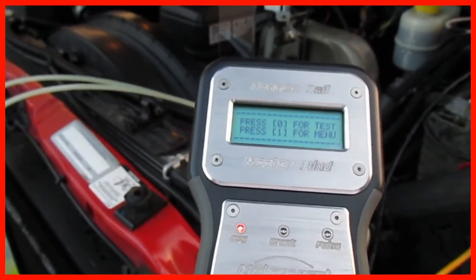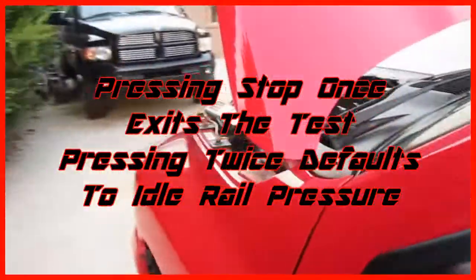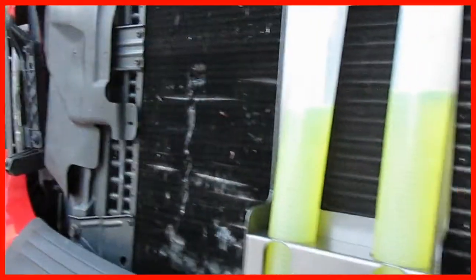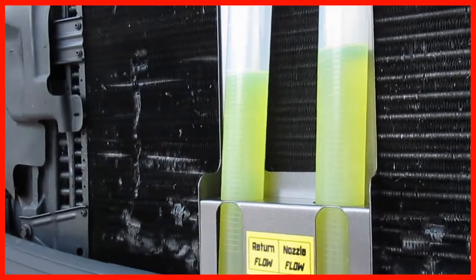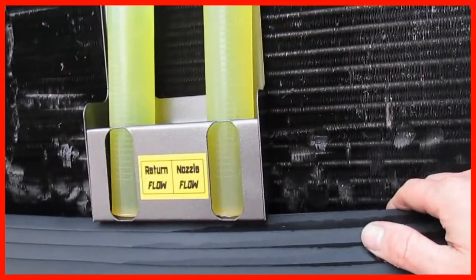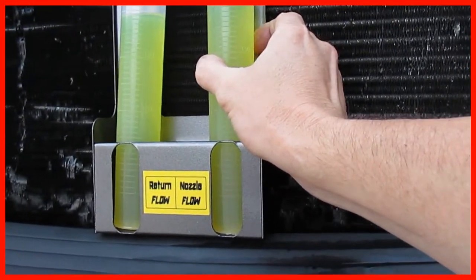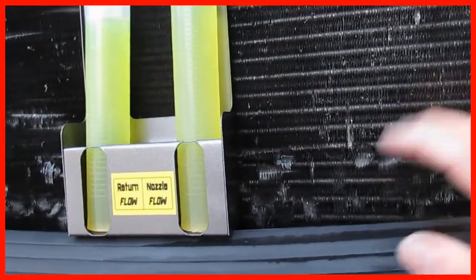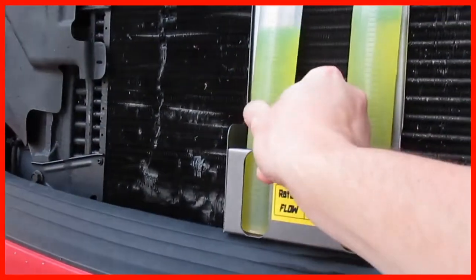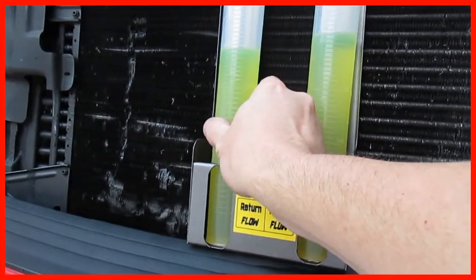Then we'll push stop twice — it brings our idle right back down where it was. And that completes the 1600 bar test. We were at 117 or somewhere along those lines. This is a stock injector that we've got in a fixture, and it looks like we put out about 212. I think we were at 117, so roughly they'll put out about 88 to 90 milliliters — somewhere along those lines. In the return we said we were at 135, and we're at 195 — that's about 60. That's still within specification.